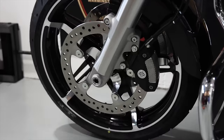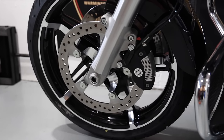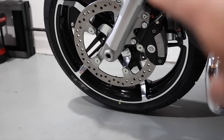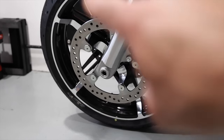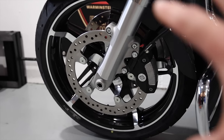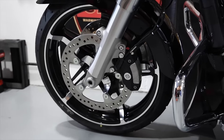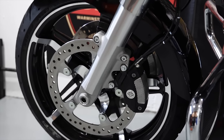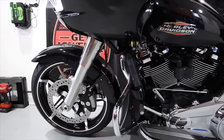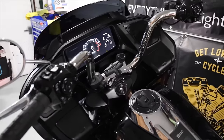While that's booting up, I want to share a tidbit - I've been looking at this rotor and I said to myself this rotor has to be bigger than last year's standard models, and guess what, it is bigger. The standard 2024 Road Glide and Street Glide front rotors are 12 and a half inches across; previous year models are either 11 and a half or 11 and three quarters. So even assuming the same brake calipers, bigger rotors means better stopping power, on top of everything else like the liquid-cooled heads. Love this bike.